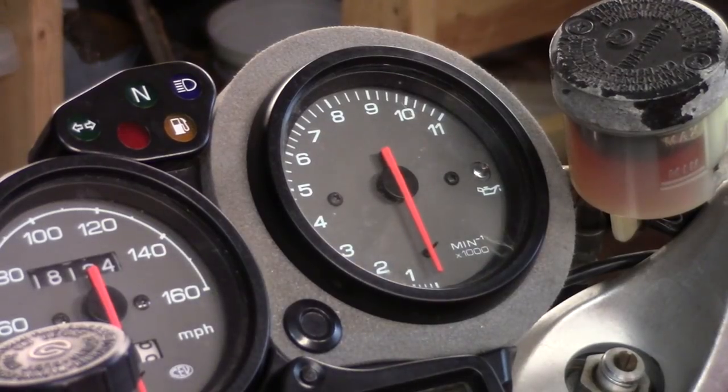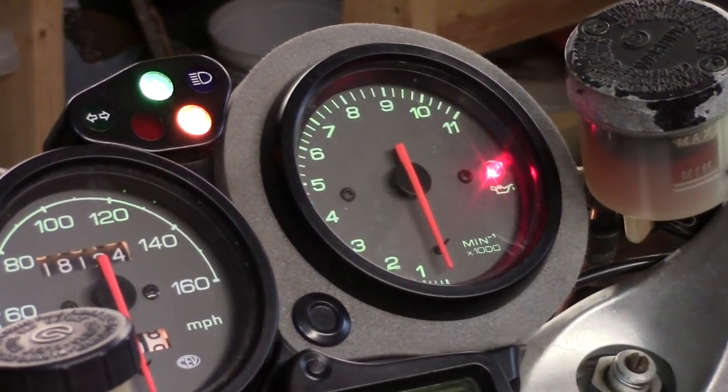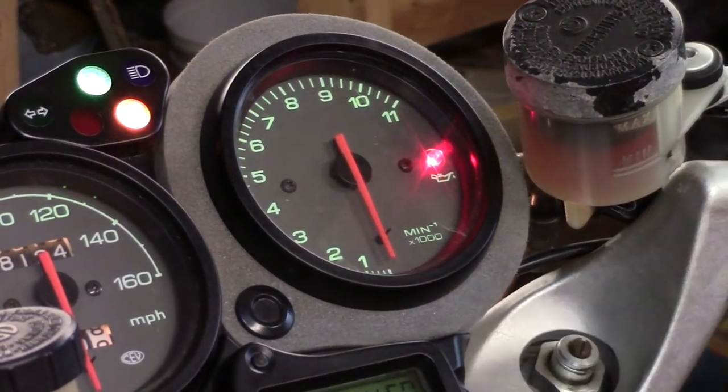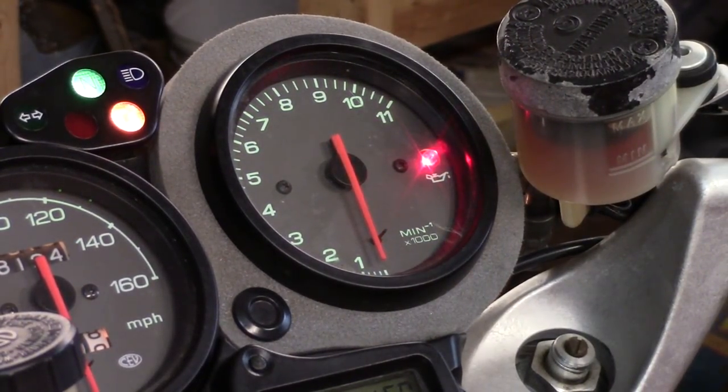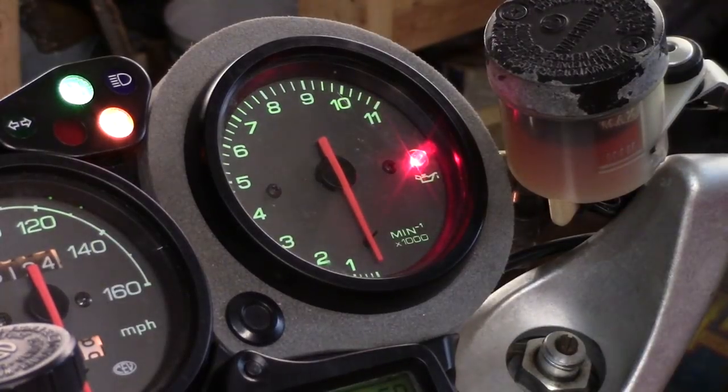I went back on my camera, looked at the videos, and the oil pressure light stays on but the neutral light goes out — I had it backwards. So we'll do it again now that I've got it connected right. Key on, all the lights are lit up. Let's push that shift lever down — first gear — and look at that, the neutral light goes out. Now let's crank it and watch that oil light. The oil pressure light went out — I've got oil pressure! Let's connect up the fuel pump and ignition and fire this baby up.